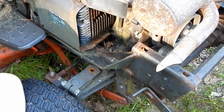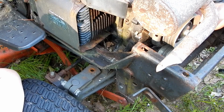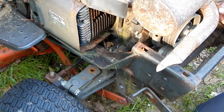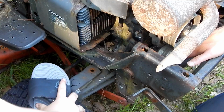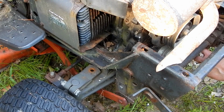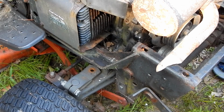All right, let's see. We got to lift up the front of the motor and pull it forward towards us, but a couple of things stopping that from happening are going to be this belt, okay? So what we want to do is take these two belts off. How? Well, this is a belt tensioner. See this? This pulley is spring loaded. It's being pushed that way, pushing on the outside of these belts to keep them tight. So if we push it that way, it'll loosen these up enough so that we can pop them off. What size do you think that is? Well, I don't want to unscrew it. What we'll do is unhook this spring, that will move out of the way, and the belts will come off real easy.